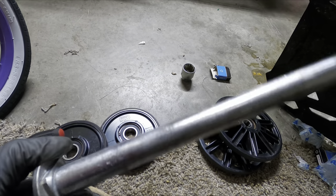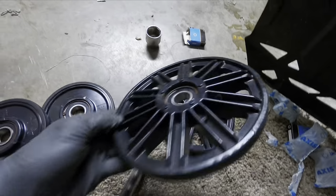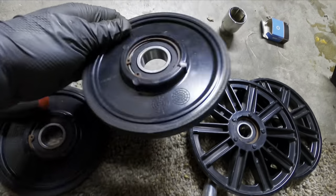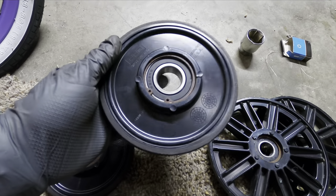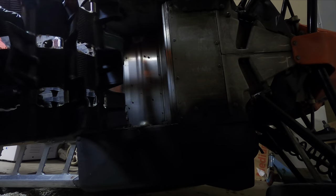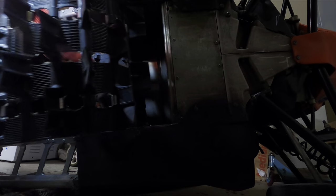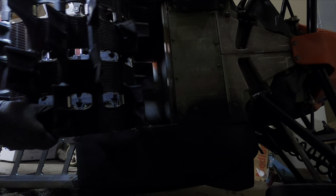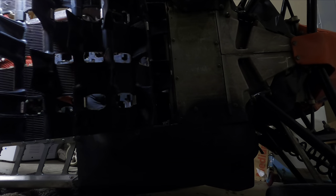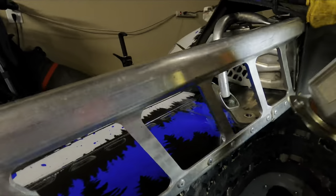The axle was pretty corroded and rusty, so I used about 150-200 grit sandpaper to sand it off, then 600 grit to smooth it out, got some grease going in there, and got it nice and lubed up. This axle is all cleaned up — shiny and smooth. Bearings are reinstalled. Now it's time for the drive shaft.